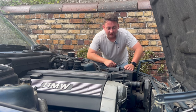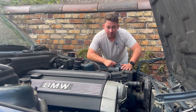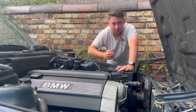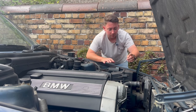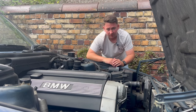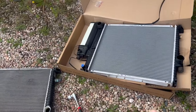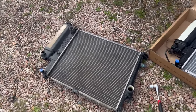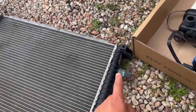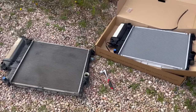So it's been two weeks since I was at the car last, because I had to wait on a new radiator coming - there was a ten working day lead time on the delivery. Off camera I've completed the thermostat housing and the belt, they're fully bolted up. The next step is to look at the new radiator, make sure it's the right one this time, and then fit it. Here is the new radiator - as we can see it is the correct size, the correct one for the car. All of the ports match up and the dimensions are the exact same.